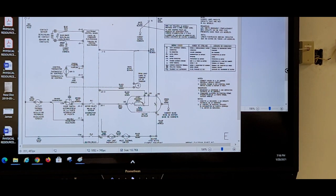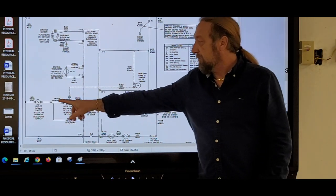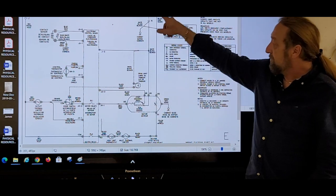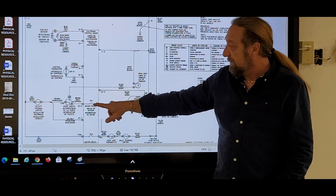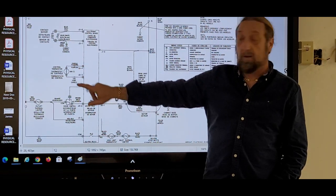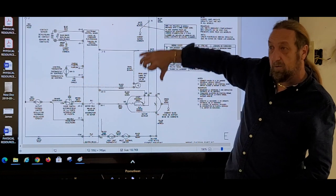As long as the door is closed, you should get to 120. This switch is closed and that fuse is closed, you're going to have line one here. And your neutral is going to go through the motor, so this is going to be open and it will not close until you start the dryer. So you will have line one and neutral backfeed through the motor, you'll have 120.